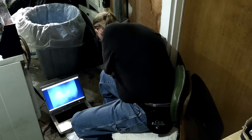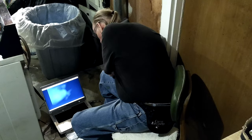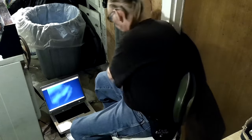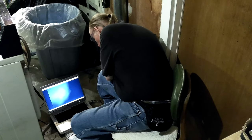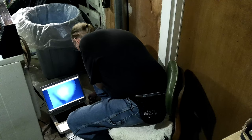I think it's hitting lint the whole way - I think there is a lot of lint in there, and that may be what ruined the heating element. Lint is the first cause of making your dryer overheat and burn up your heating element, which is what it did. Of course it's really old - I don't know if we've ever put one in it. This thing was made in '93. Maybe one, I just don't remember.